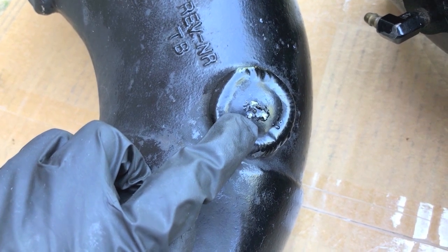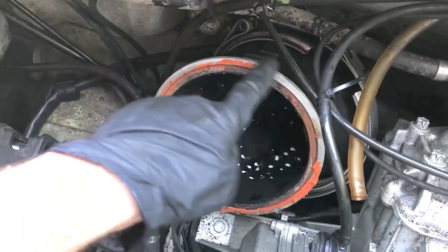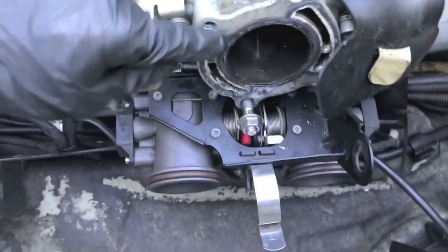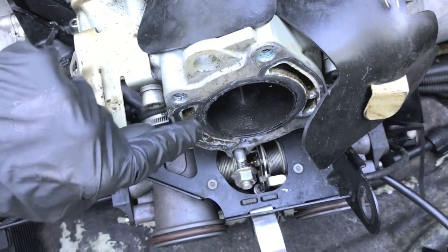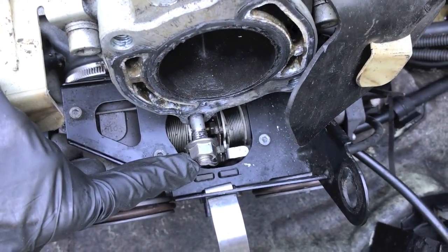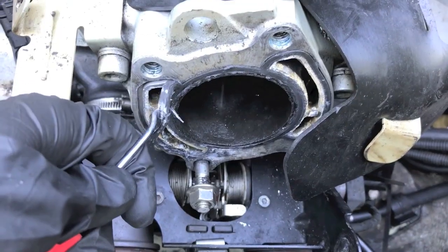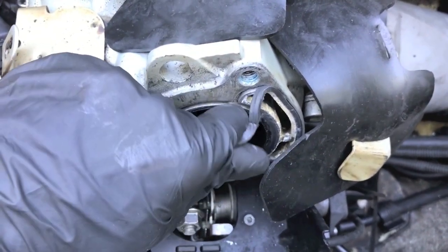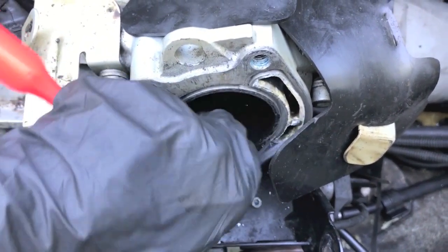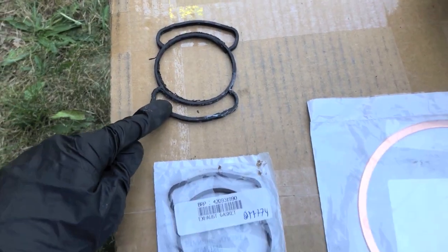The top manifold is removed. I will slowly peel this rubber gasket portion off to make sure that this face is bare and clean. Also, the old rubber gasket in between the portion here and the manifold I will slowly peel out as well. That is the 15-millimeter bolt — just by loosening it a bit, the actual part right here just slides up and off. Using an awesome little hook tool from AutoZone, slowly and carefully pull this rubber gasket out of the actual area it seats in. Old gasket is fully removed.